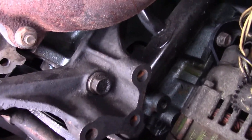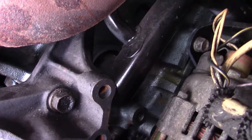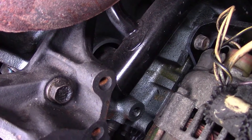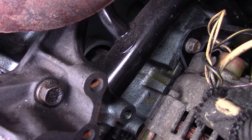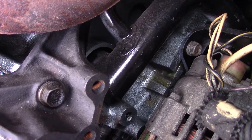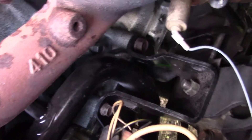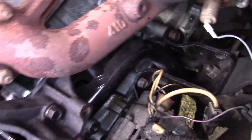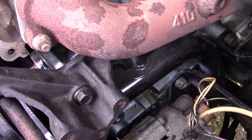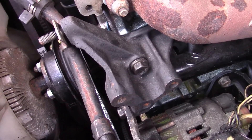The only thing that's come up is a coolant leak. You can see it where that water manifold goes into the block — there's coolant down there. I don't know if I cut the O-ring going in or if it's just slightly too small. We're going to try and change that. The difficult part is that the water manifold passes through the engine mount bracket, so the unknown is whether I'll have enough room to pull it out of the block and get that O-ring off, or if I'll have to support the motor and unbolt the bracket.